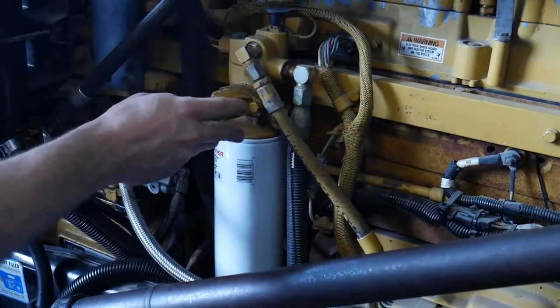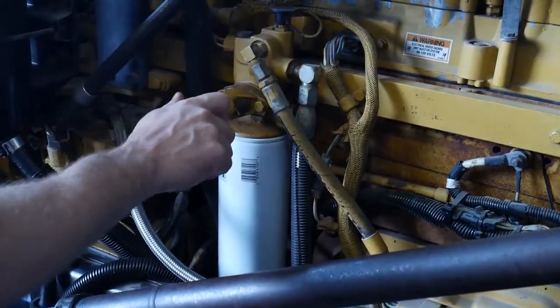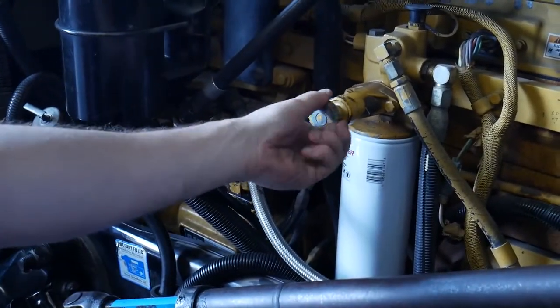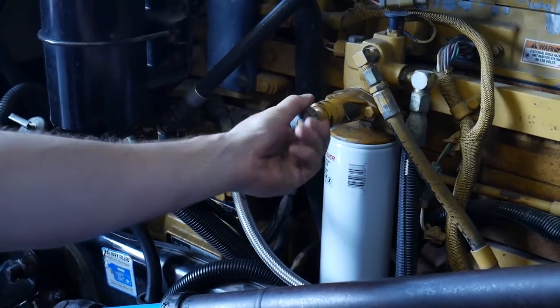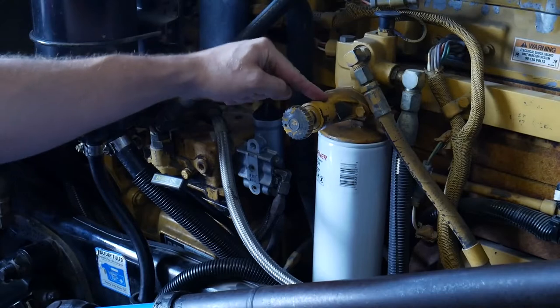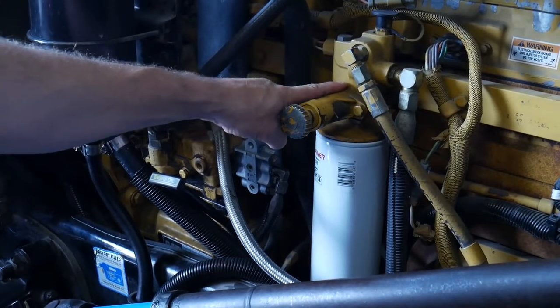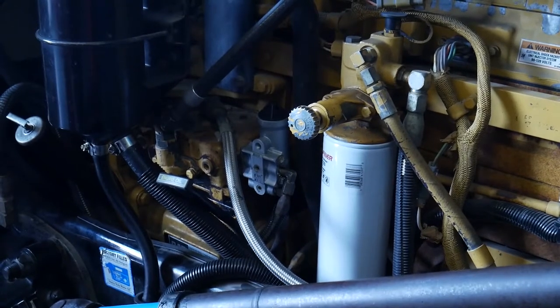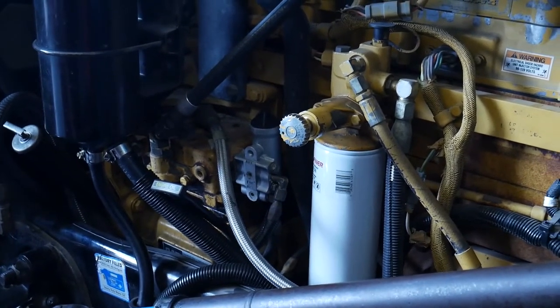Even if the pump is in good condition and not leaking too much, the key is that after you're done pumping, you seal it back off. The reason we need to seal it back off is to prevent any air from getting past that seal and into our fuel system, which will cause air in the system, leading to poor combustion due to poor injection pressures.